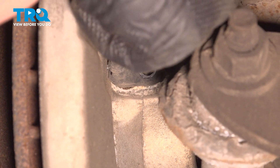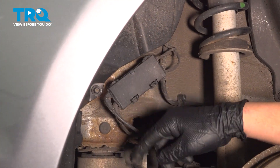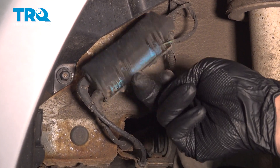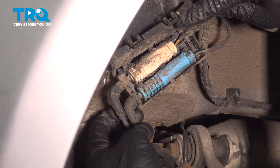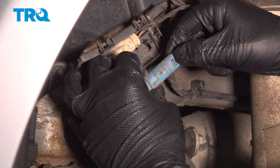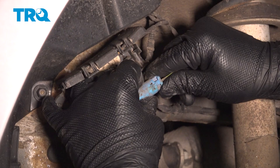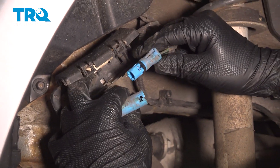Give the sensor a little wiggle and pull it out. Go up to the junction box for the connector — pull up on these two tabs and open that. For our ABS sensor, pull the blue one, push on the tab, and pull straight back. Remove the connector.